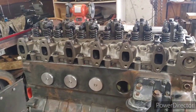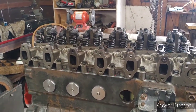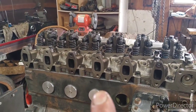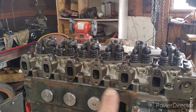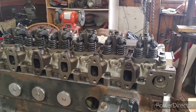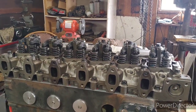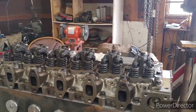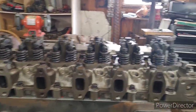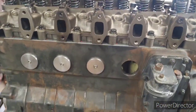It's a long process — I'm going to take a little break, check the fire. There's a pattern for the head bolts and a torque sequence. Once you get to final torque, you've got to go 90 degrees. I'm going to wait and not start that right now. Everything's just snug and we'll go from there.